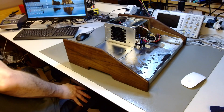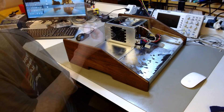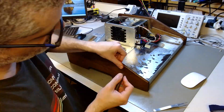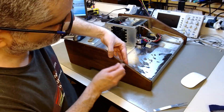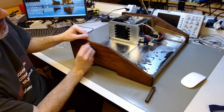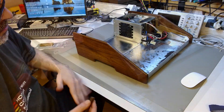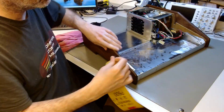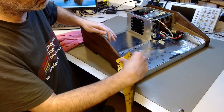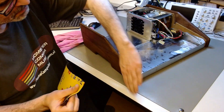Now the case wood panels had some scuff marks and some cracks, and I'm going to use this wax that tries to imitate the color of walnut. I first use a lighter toned wax and then I move on to a darker one. I'm already using the darker one now — I fill the cracks, the grooves and the scuff marks with it. Then afterwards I use very fine sandpaper just to sand off the excesses so we have a seamless result hiding the original cracks and scuff marks.